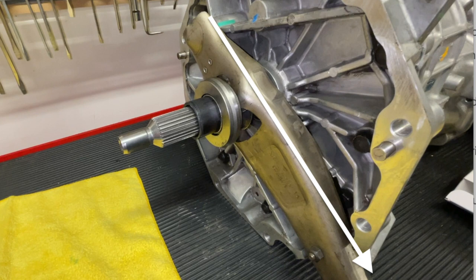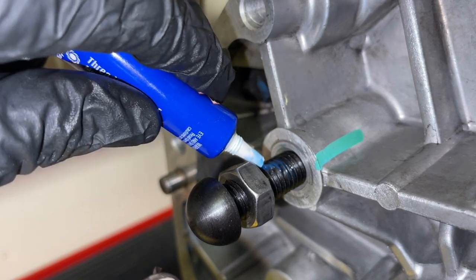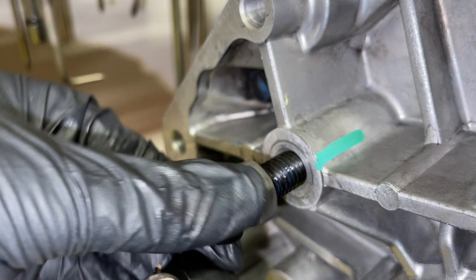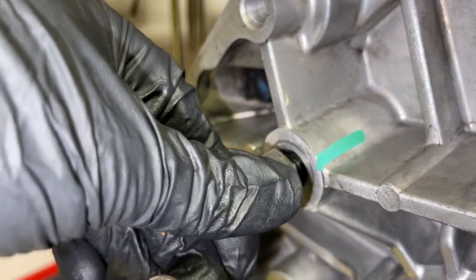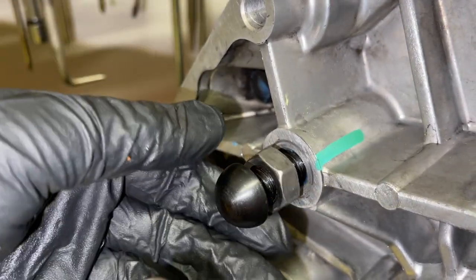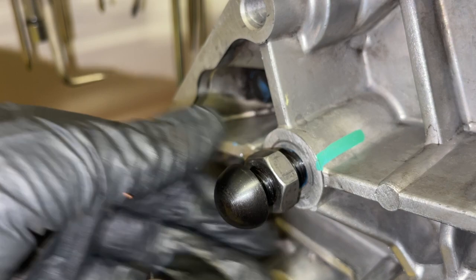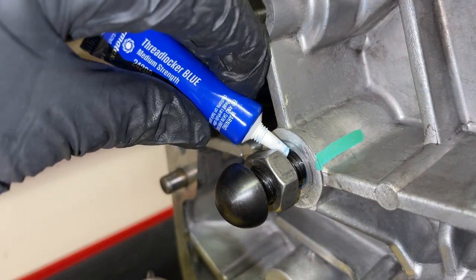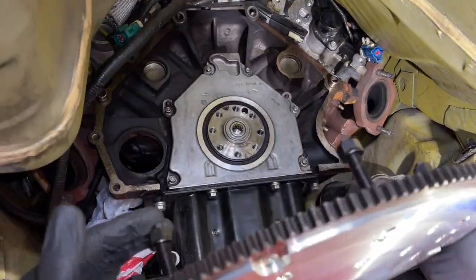Since we're changing geometry and everything like that, it might not be perfect — we are using aftermarket components and trying to get it to swing on a range it wasn't really designed for. When you're happy with where it's at, remember to go back and put Loctite on the pivot ball stud and tighten down the jam nut nice and firm. With the T56 Magnum you might have some differences in the case — it might not go in as deep, you might have to cut some threads. On the stock T56 this worked out perfectly, so for my application I threaded the pivot ball stud all the way in and that was about six millimeters.